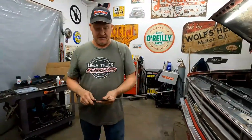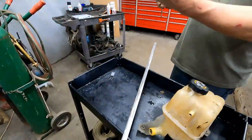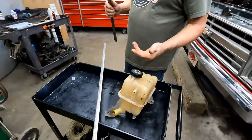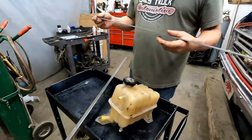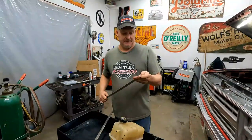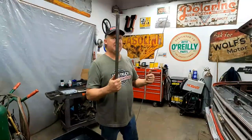We're going to do the whole thing with this, which is 1/8 inch thick, 3/4 wide steel. This is 1/8 inch thick, 1 inch wide. I picked it up at Menards this weekend. Lowe's, all those stores have that stuff. They'll be marked with a color on it that'll give you an indication what they're good for. This is pretty strong metal, and it is great for welding, and that's what the color code on them will tell you. We are going to weld on these, but if we weren't going to weld on them, we could have done them out of aluminum probably. They sell aluminum strips just like this.